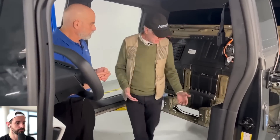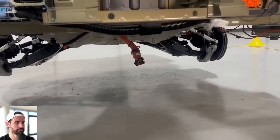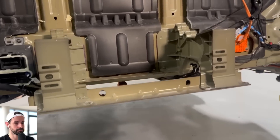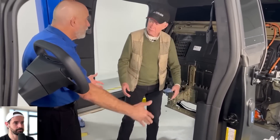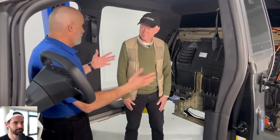Taking the batteries out of these things is always a discovery — how are they held in, just the bulk of it, how do you take it down safely? This one came out quite easily. What's cool when you pull all this out is you start to see some of the castings right into the passenger compartment. Tesla's taking castings further and further on this truck. The rear seat structure is a casting, and they've extended that rear casting to include the rear seat. The front seats are also on castings — instead of typical roll-formed stamping for a seat track, they're casting.